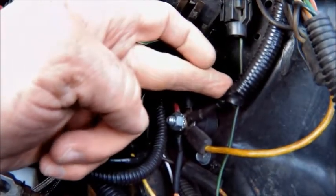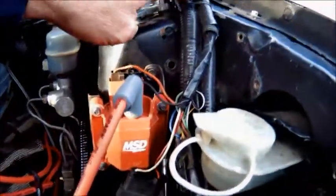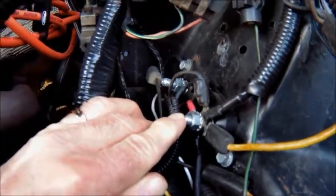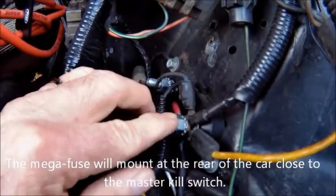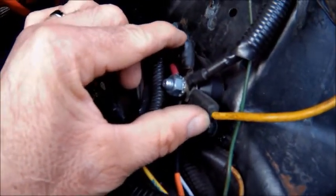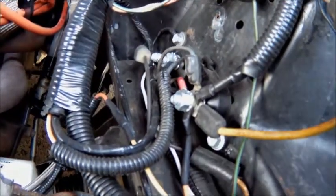This is the main supply coming in, and these wires would normally attach to the positive side of your starter solenoid. But since the starter solenoid's in the back, in order to maintain the factory harness the way it was set up and not have to modify it like crazy, I just ran a power wire up to the front of the car. One thing I don't have on mine yet that I still have to put on is another one of those mega fuses. So right now when my car is live, this doesn't have any protection — I still have to add a mega fuse to that. So all these connections would normally go to your starter solenoid, but since the starter solenoid's in the back of the car now, I ran a power supply wire up to the front to this junction box. That way my factory harness is untouched up here — I didn't have to modify my factory harness in any way.